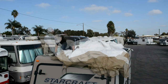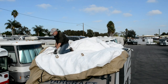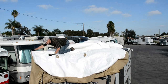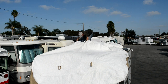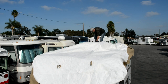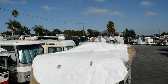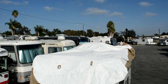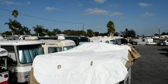Work your way back along each side of the RV, pushing the cover over bit by bit as you go. There are a couple of tricky parts: that pesky wind can mess with your technique so be patient and get your helper on the upwind side. Also, as you spread the cover across the roof, remember where the vents, antennas, and skylights are and step lightly — breaking one of those components or tripping on one could definitely ruin your day.